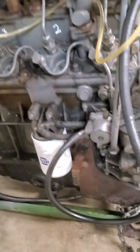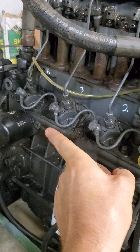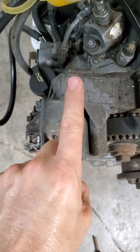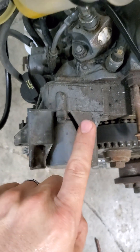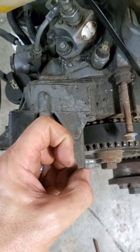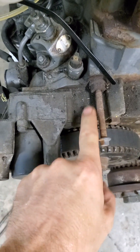Because it sat for a long time, the fuel rack - the fueling rack for acceleration - was jammed in towards the back direction and it was stuck. This fuel shut-off solenoid works backwards: when power is applied, the solenoid comes out and pushes a little teeter-totter. With no power applied, the fuel rack is pushed all the way towards the back of the engine and that shuts off the fuel. When you apply power to the solenoid, the claw that pushes the fuel rack is removed out of the way, and then your governor mechanism pushes against the fuel rack when you use the accelerator.